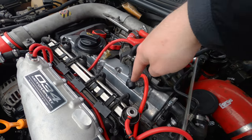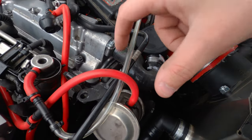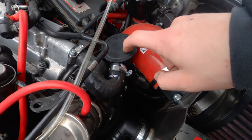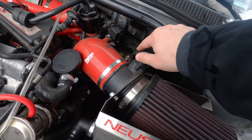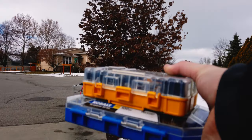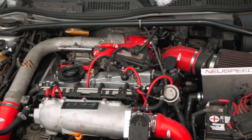This adaptation is a hypothesis, so let's talk about my game plan. There are some kits and people online who say you should delete the entire PCV system and simply replace it all with a catch can. Every part of my PCV is now brand new, and I don't really see the need to eliminate a system that was put there for a reason and is working just fine. In engineering there's this concept of redundancy — two different systems preventing the same issue is a lot better than one. I want to make an inline catch can in addition to the PCV system.